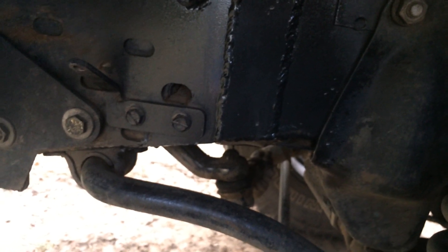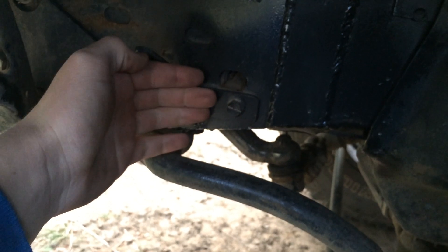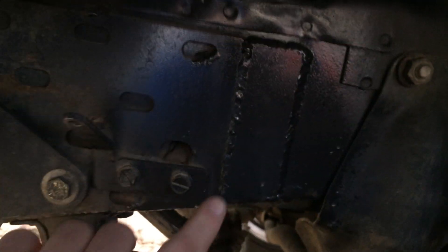It was quite a big crack. Every time I would turn to the right, the frame here would pull all the way out and there would be a gap about that big between that part of the frame. I'll show you a couple pictures and I'll show you the process I did to get this piece welded on. I also welded a little piece to the bottom that kind of wraps around.